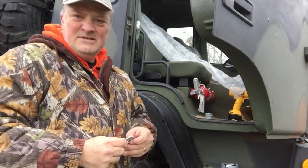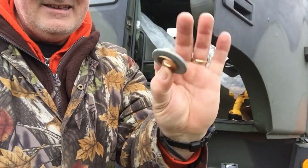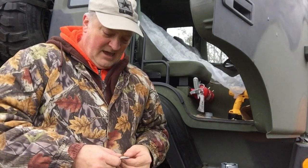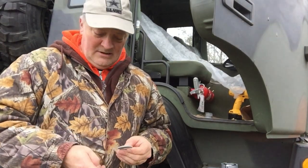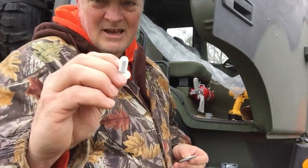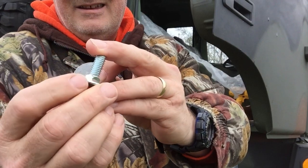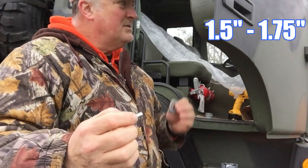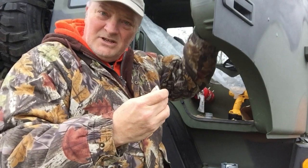Now for security purposes, I'm gonna put a washer stack on the very back so that nobody can pull and rip the bolt through. And I'm also going to put some Vulcom on the back of it. That's exterior sealant, and it's also paintable. And also you want to make sure that the bolt that you use is a carriage bolt, has that square head or square part there, and that it's not very long, because there's a window here and you don't want to put this bolt all the way through there and impinge on the window coming down.